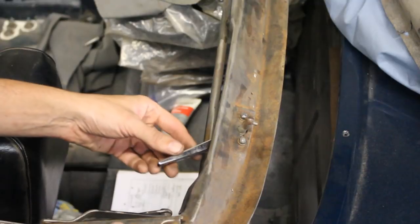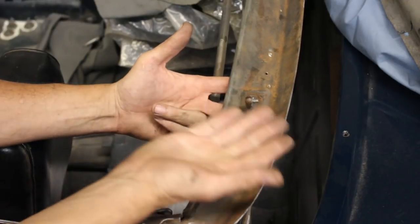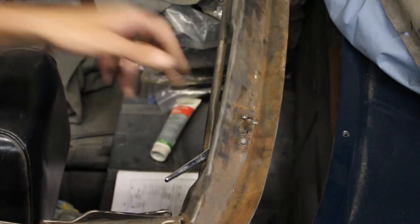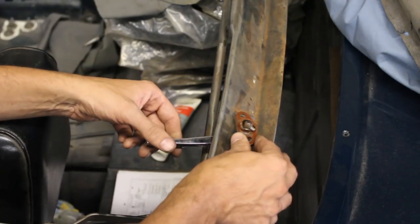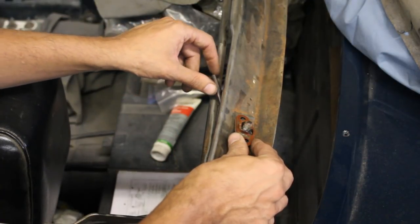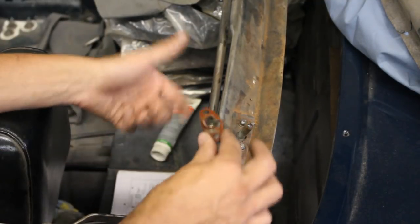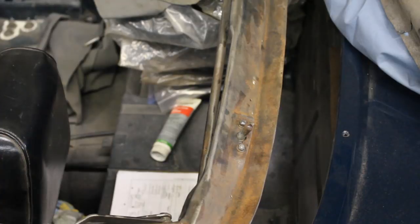I don't know if you're gonna be able to see this, but I'm gonna move the camera. And of course these handles are handed too, because they have to be in this position, vertical, which when this flips the other way around, this points to the front, so this can go inside that part. So this goes inside this part like that, and when you turn the handle, this slides on this sloped part here and pushes the frame down. So that's how it works. It took me a while to figure out which one is left, which one is right, so I decided to show it here so everybody knows now.